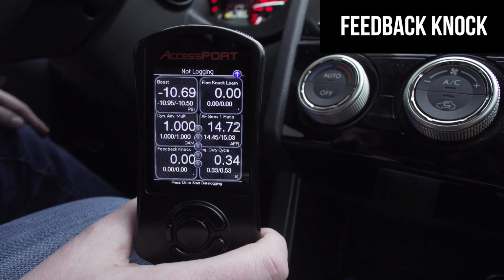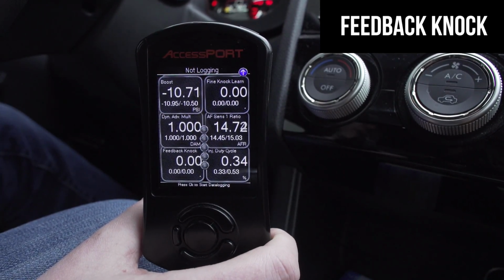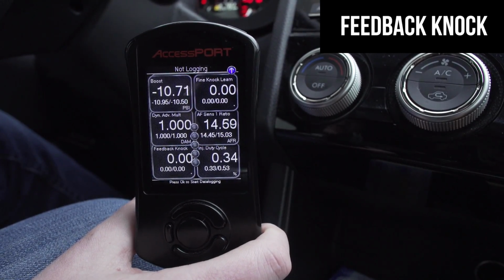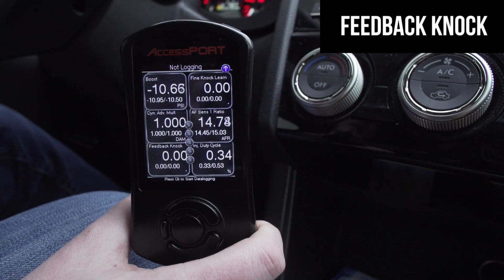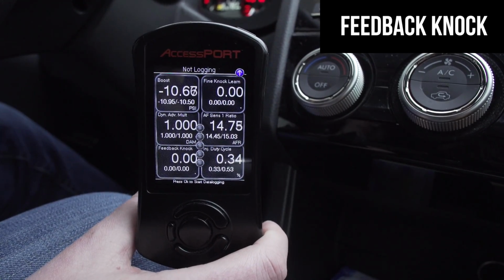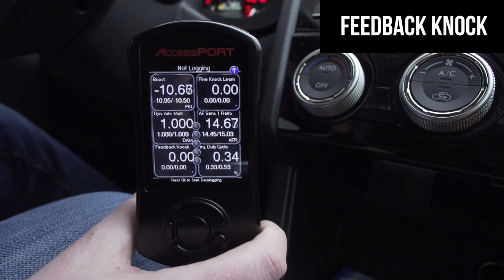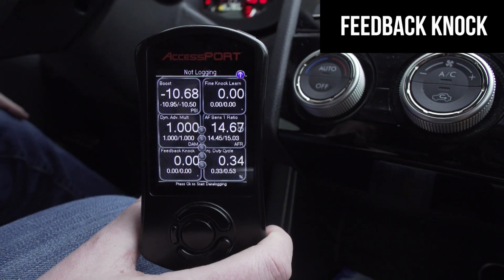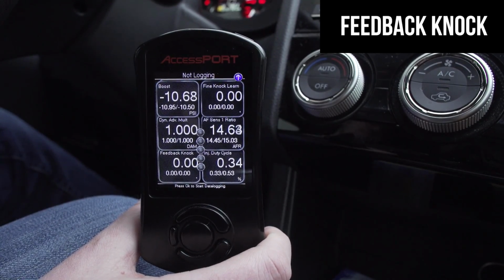And that's totally fine. Now Cobb even states a -1.41 up to a -2.8 on these cars is considered pretty much normal, specifically when you're just cruising. This isn't including wide open throttle stuff. This is just putting around town or going on the highway. If you get consistent readings of -3 and up, you will most likely start seeing issues with DAM dropping as well. Normally, sometimes those do correlate. So readings above -3, definitely a concern and may want you to reach out to us. But a -1.41, -2.8 from time to time, completely normal.